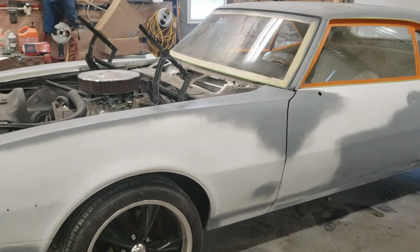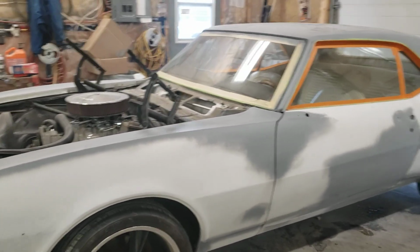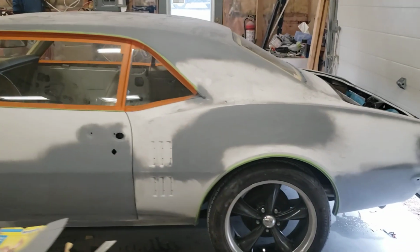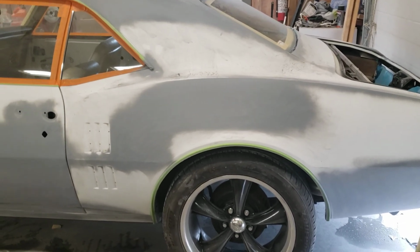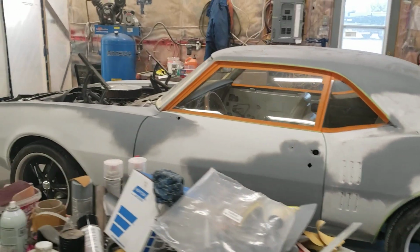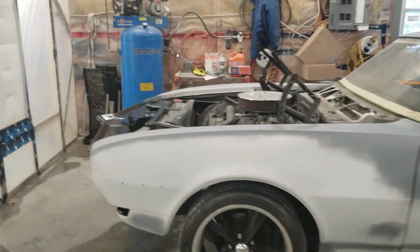We threw a little bit of white on it just to kind of blend it in. I let that tack for just a couple minutes, and then we did our first coat. I got the gun set at about 26 pounds. It's a 4:1:1, about a mid-grade paint, Limco Supreme Plus, just single stage urethane. It seems to have covered the parts nice. More importantly, it laid down nice and glassy. It looks like clear coat over base.